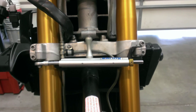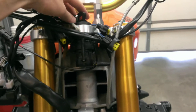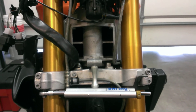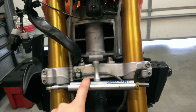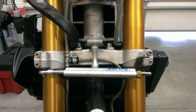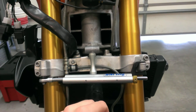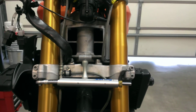That's a steering dampener and that's how to install one. There are other variations — sometimes they put them on top of the triple and anchor it to the frame, or they mount to the bar, so there are different ways to dampen the steering input of a motorbike. This is just a lower triple-attached steering dampener. It's a pretty easy change on a Tuono. The RSVR and Tuono steering dampeners are the same, though this particular part may be different — but I just reused it. If you have any questions, put a comment in there and I'll answer it. Thanks for watching.